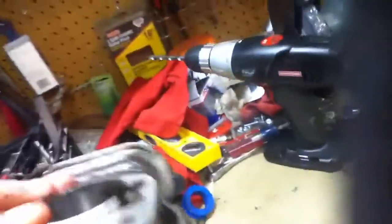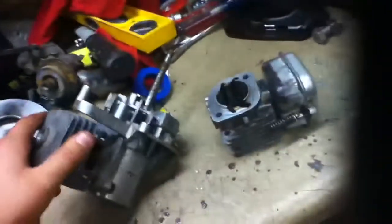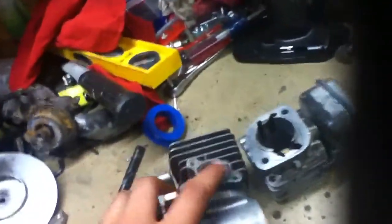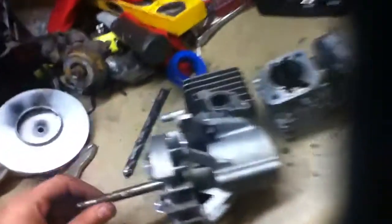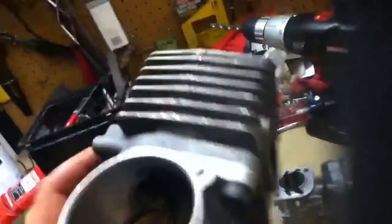Fast Suzuki — check him out. Great guy on YouTube, great guy in real life. I'm always collecting dead weed eater engines because I like to turn them into steam engines. He was scrapping these two. I gave him this one originally — it was a Bolens 31cc. It ran beautifully; it was brand new. The clutch was crap, but it ran beautifully. We tried to make it into a weed eater bike, and this cheap cast aluminum couldn't take it and it sheared. When that thing worked, it ran beautifully. I had a rubber disc clutch and the rubber just expanded. The clutch was trashed, but everything else ran great.